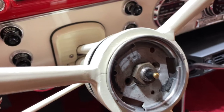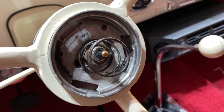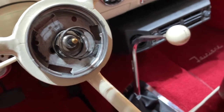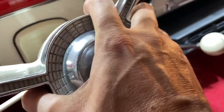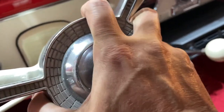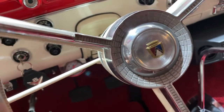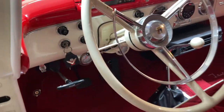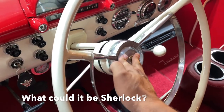I've got my horn wire hooked up underneath the steering column. Make sure this is set the way it's supposed to be with the little cup inside the shaft, then the spring that goes on here, and our clean contacts on the horn and the trim ring. What goes in — you cock it about 15 to 20 degrees, set it down, then spin it and get the contacts right. Hook up the battery — moment of truth. Nothing.